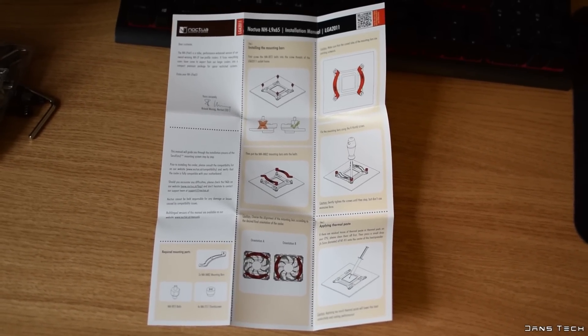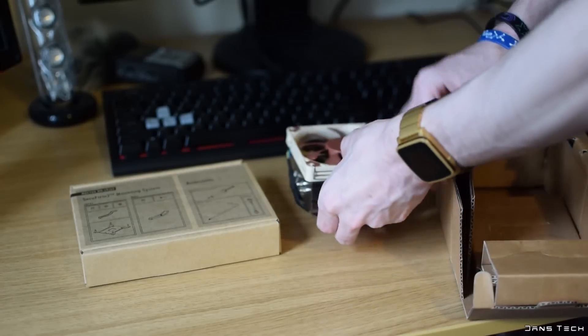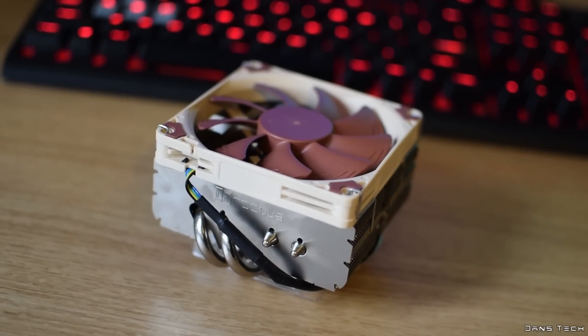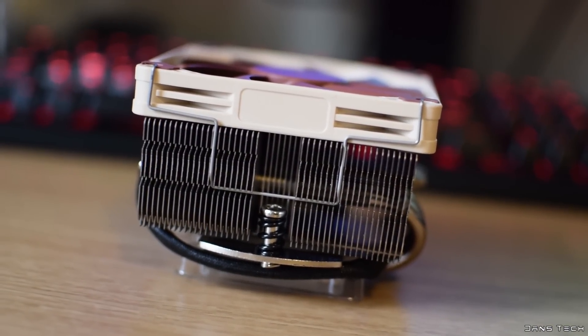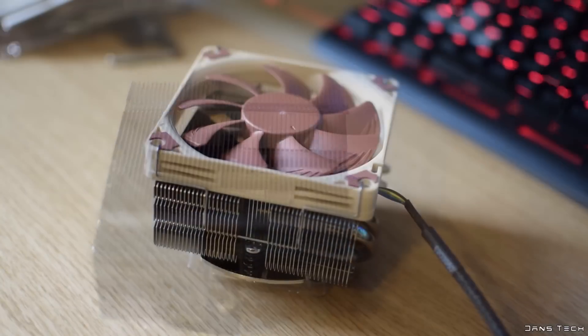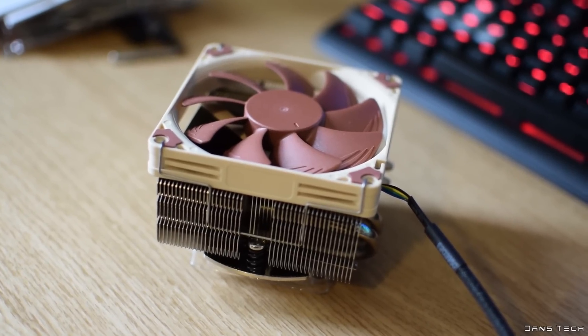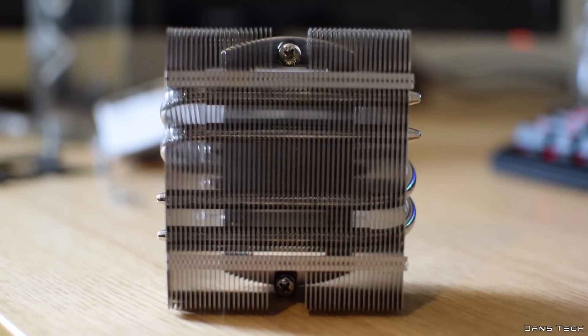Making this cooler look like child's play to install. On to a further look at the unit — the cooler's dimensions with the fan attached are 95x95mm, with the height being 65mm, hence the name. These dimensions make this extremely small, a very small amount higher than the Intel stock cooler, making it very ideal for cases with very little cooler clearance. As for the weight, it comes in at 413 grams including the fan.